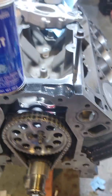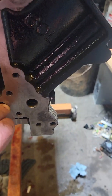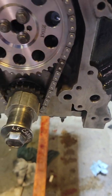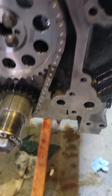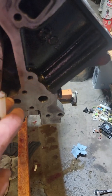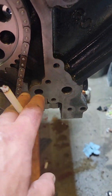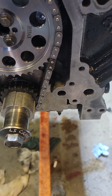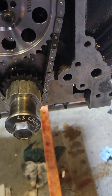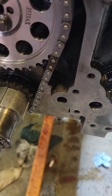Now there are some people that talk about spraying this with copper coat, high tack, or putting RTV on it, and I'm going to tell you why it's not necessary. This is under pressure, so your oil pump has a variable pressure spring in it that will relieve the oil pressure when it gets to a certain number — whether it's 40, 60, 90 PSI — whatever the spring is set at, and that's going to be determined by your bearing clearances. So if you have just a hair bit of oil pressure escaping here, all it's going to do is spray onto the timing cover, and if it sprays on your chain it's not hurting anything. Right now the only way the chain gets lubed is from oil coming down the crankshaft, so additionally lubricating the timing chain isn't going to hurt anything.